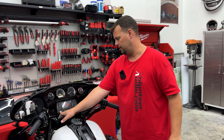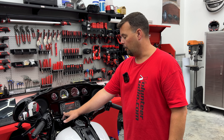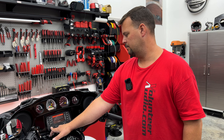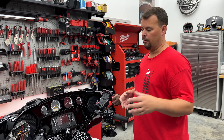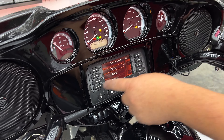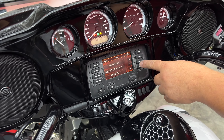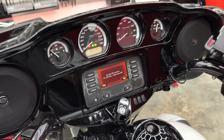This one's not a touchscreen, so it's a little different in how we do this. Just keep holding it. Once that accept screen goes off, you'll see we're in the service menu. This particular radio has physical buttons on the side to navigate. So we're going to select Audio, select EQ, then select the option that gives us that info icon — just as if we were touching the screen. Our current EQ version is 01off.bin.